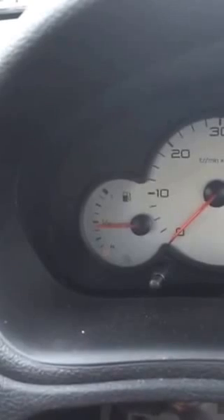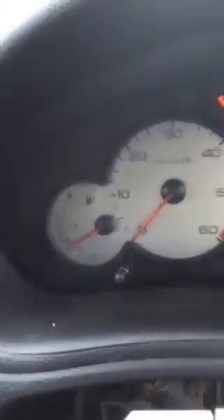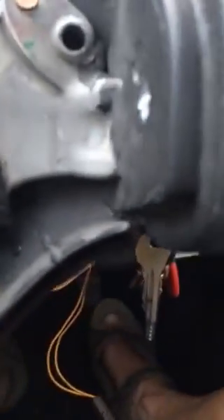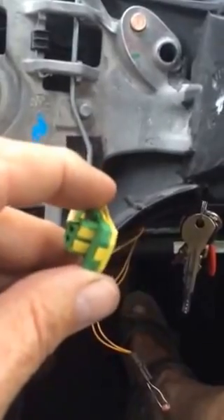It now knows there's a fault in the airbag system. I can't just put the resistor back in because it will still tell me there's an error — I have to turn the ignition off, put the resistor back in, and then turn it back on. And if everything's happy the alarm will go out — and there it goes. So if you know that side of it is good, the wiring from here back to the controller underneath the ashtray is all good. If you've still got a fault, it has to be beyond here through the clock spring or in the airbag itself.